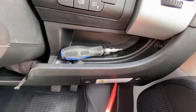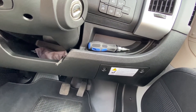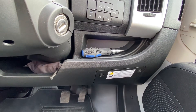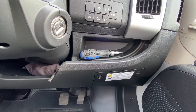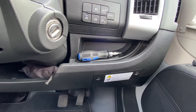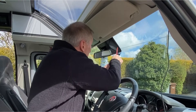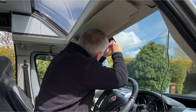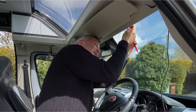The fuse box is here — there are a couple of Torx screws, a T25 there and one about there, and then this should all drop away. I'll show you when I go into the fuse box. I need to find the correct fuse to tap off to get a constant live. With parking monitor mode this camera will be able to view what's going on outside your van at night as well, viewable on your phone. Everything is neatly pushed behind the trim there — it gives it a professional look.